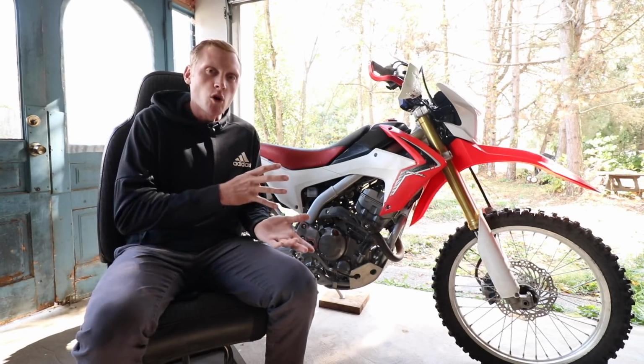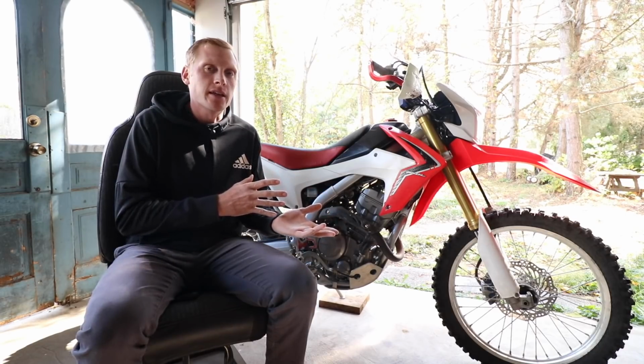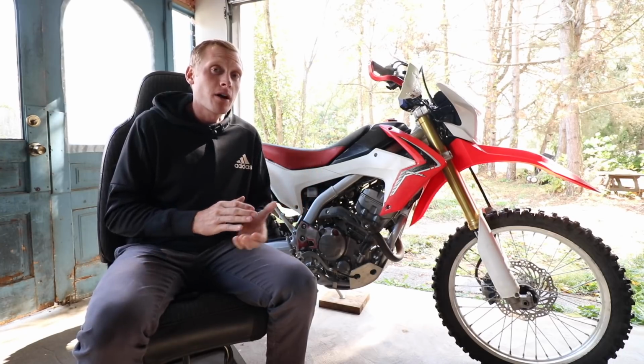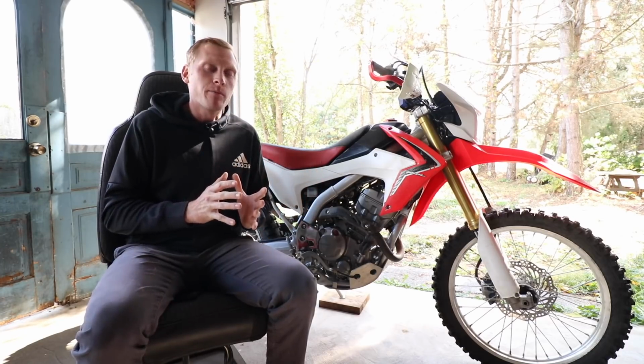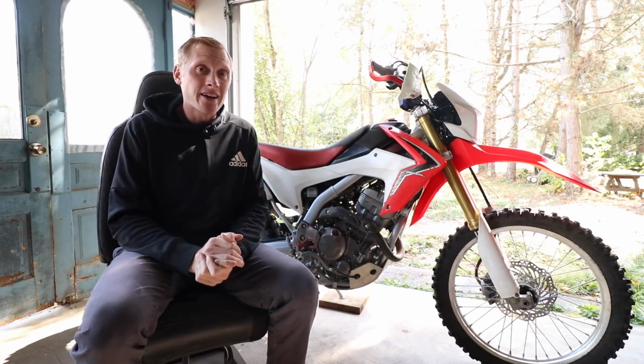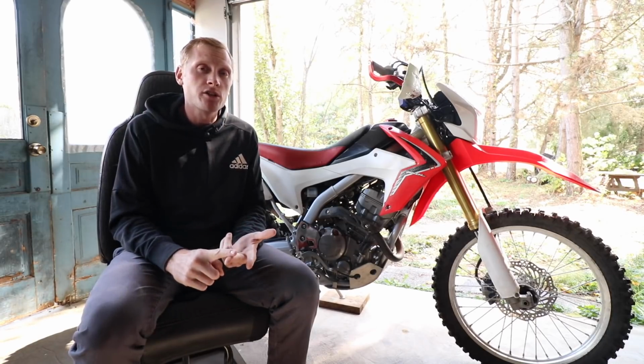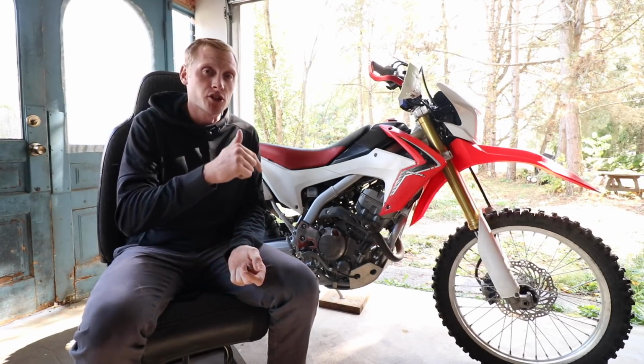And I've got to say, I rode a friend of mine's CRF250L and it felt like a slug compared to this. That's also to do with a couple other mods that I have done, but you will definitely be able to notice the torque on the low end, and for off-roading, that's a major win. So that is the sprocket size that I recommend. Go ahead and pick you up a 13/42 sprocket combination. I'll link those in the description below as well.